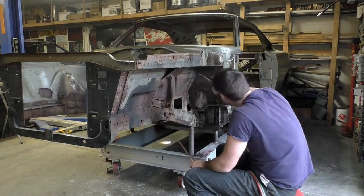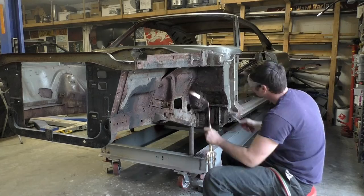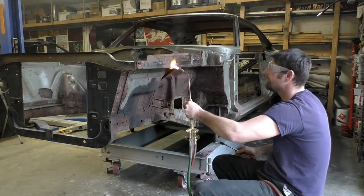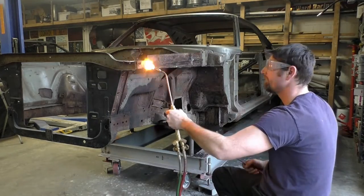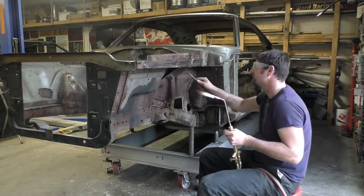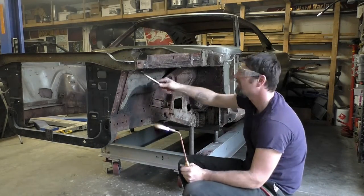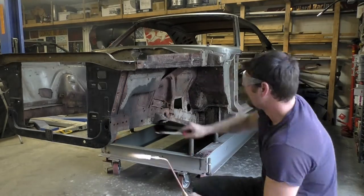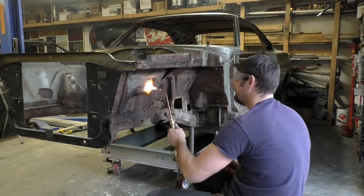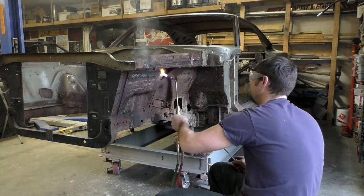I'm going to try to start from the front and work my way back for the most part. I have the oxyacetylene torch with a rosebud tip and I'm just heating this up and getting all this undercoat scraped off the car. I'm doing it right now first because right behind me is an open garage door and it's real easy to let the air come out. I got a fan blowing on the other side of the garage, just trying my best not to breathe any of this stuff in. I probably should be wearing a respirator — be safe at home. Wear proper equipment, make sure you don't burn down the shop. Just take safety serious. You can also use a MAPP gas cylinder. The rosebud tip heats the area real efficiently and lets you just scrape it off.